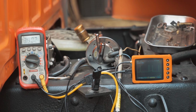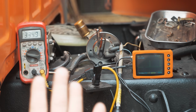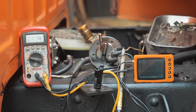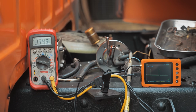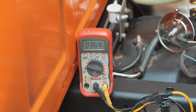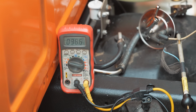It's a thermostatic gauge. And the other thing too is if you see a steady 5, at least on mine, and I'm not convinced that they're all gonna be like this, before you make the call and go inside, check your ground wire. Make sure that ground is good. So let me do that. Going on my ground wire, this is a loaded circuit now, voltage drop test. I'm reading 34 millivolts on that ground.